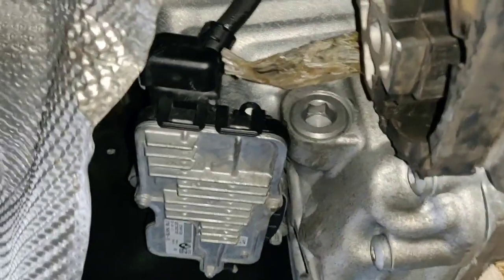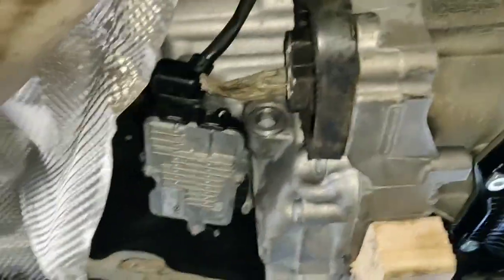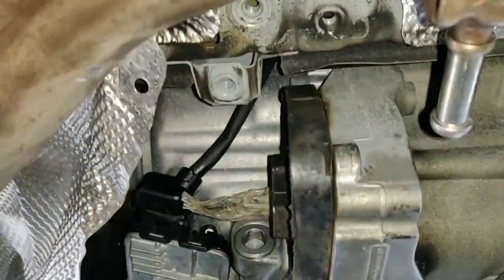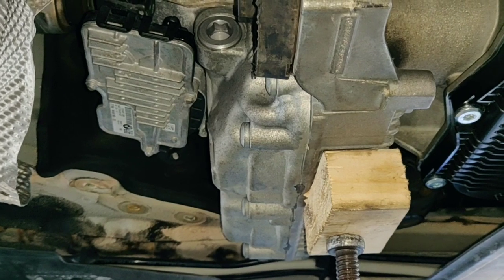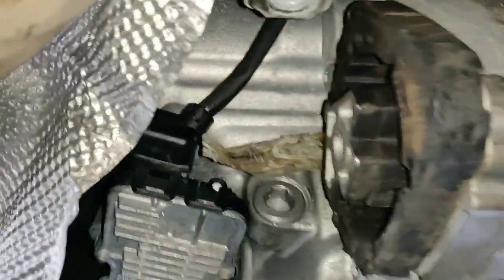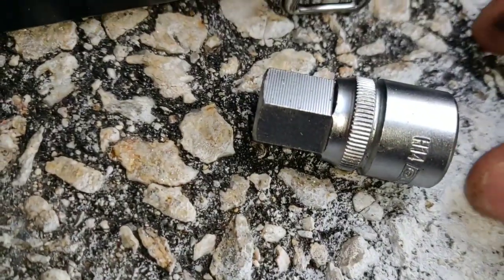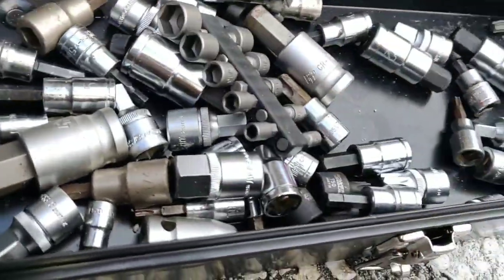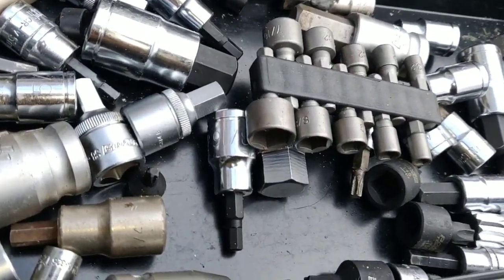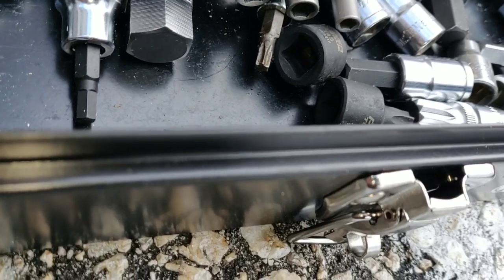Here's what we're looking at — this is the golden item right here. See that plug right there? Let me zoom out so you can get an approximate feel of where that is. There's the exhaust pipe, there's the jack holding up the transfer case. There's the transmission fluid pan. So we're going to undo that. The tool you need is an H14. I've got a million different tools and all of them are for various drain plug types — it's a crime that requires this many variations on a theme. But anyway, we're going to undo that and go from there.